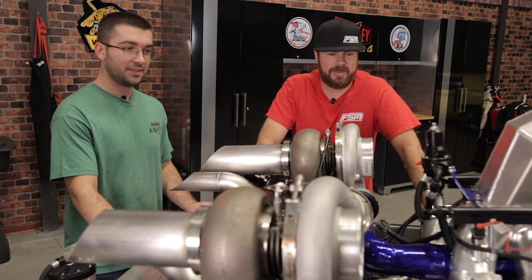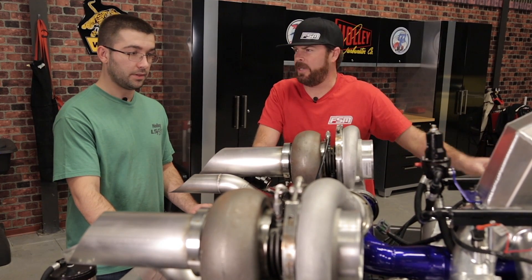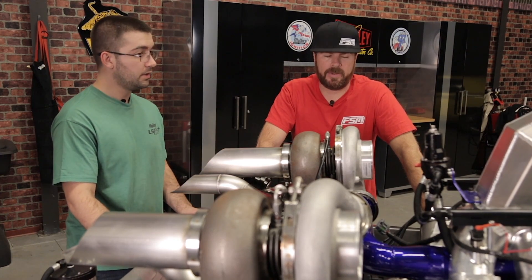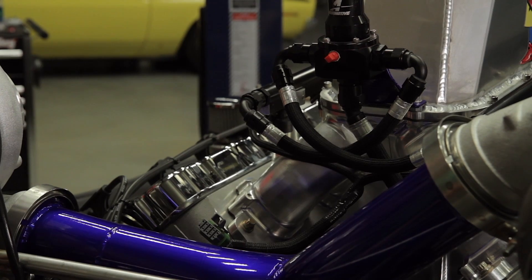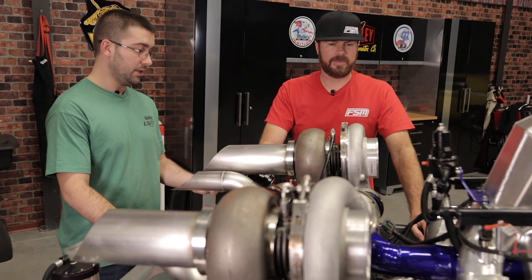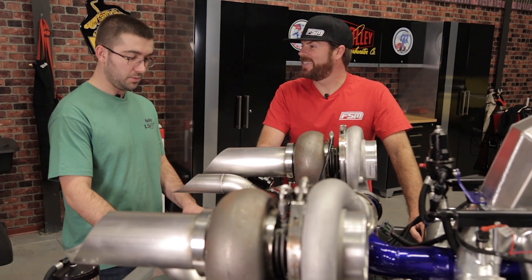The polyester version is great because it doesn't rip hair off your knuckles or make you bleed during assembly. We didn't use it on the oil system because everything there is so close to hot components of the engine — we didn't want the polyester near the exhaust since it can't handle that level of temperature. It can handle the fluid and pressure, just not the temperature, so we went with stainless to ensure long engine life.